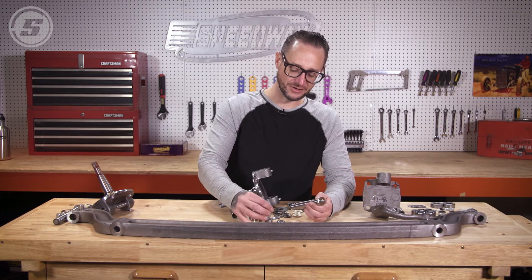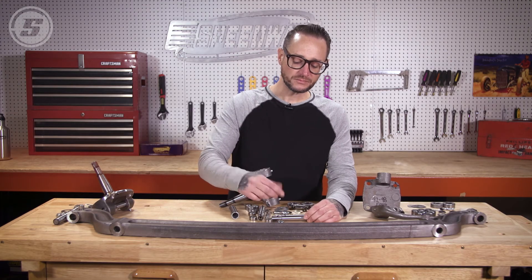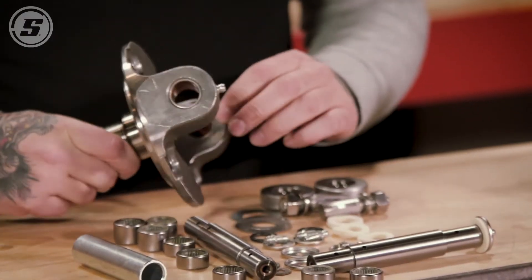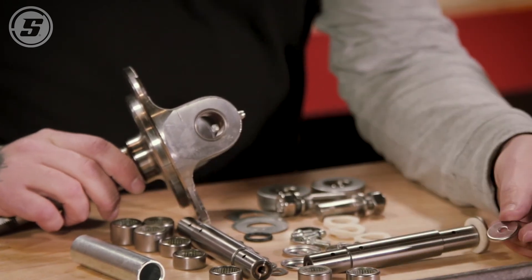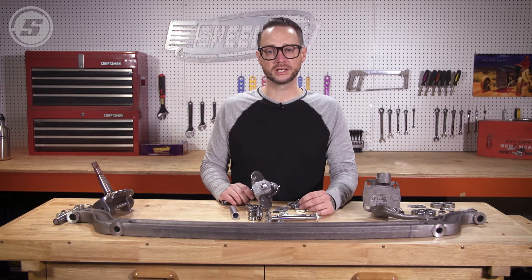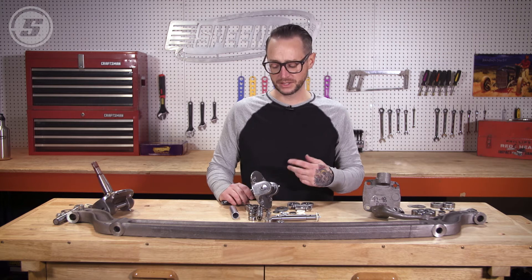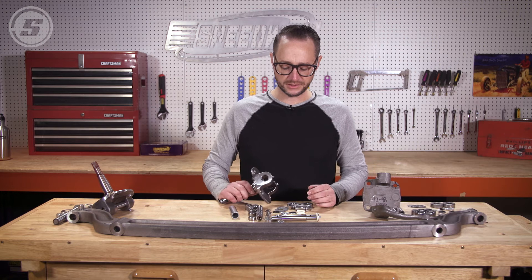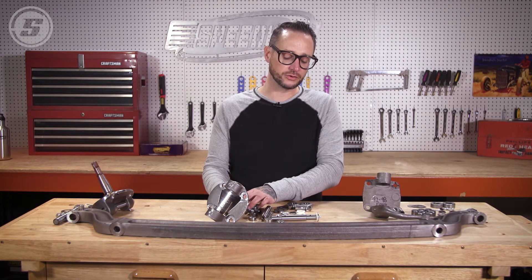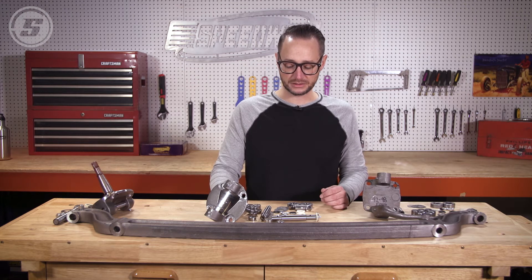The bottom is where it gets tricky. You'll see there are some o-rings, and these can throw people off — what are they doing in a kingpin set? Well, on the bottom of some kingpins they are formed or made differently, so you need a smaller cap and an o-ring to seal the bottom up. Where you would normally have nothing like on the standard kingpin set, here you have something that holds a cap in and helps keep moisture out. The grease zerk holds the cap in and allows you to grease it. Even if you've done a bunch of standard kingpins and want something that lasts longer, this kit does require extra work, but it is a much better set of kingpins and worth the money.